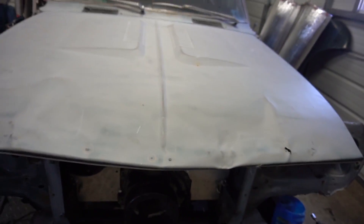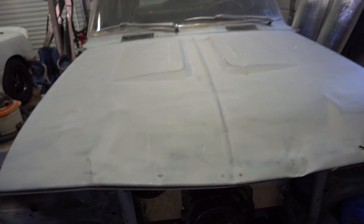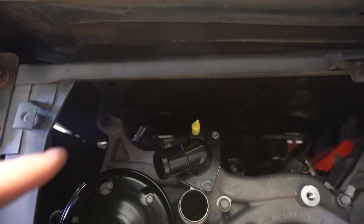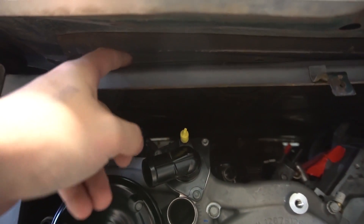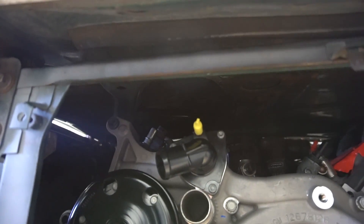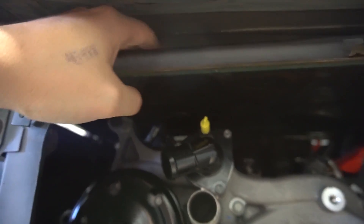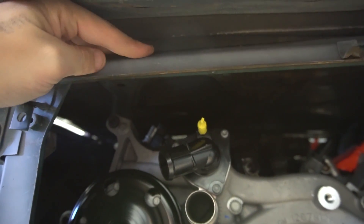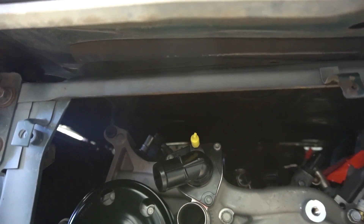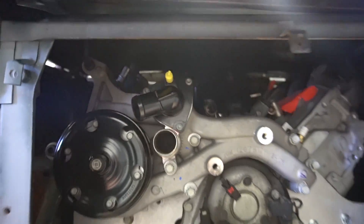As you can see, the hood is not in good shape — it was in a wreck, and it busted the grill and stuff at some point before I had the car. The rubber here is supposed to be touching it like this side so it seals this off. So I pretty much need to keep the top of the radiator cap flush with this radiator support. I'll get the hood back off and cut an access hole and get a radiator cap on the radiator so I know exactly how high it needs to sit.